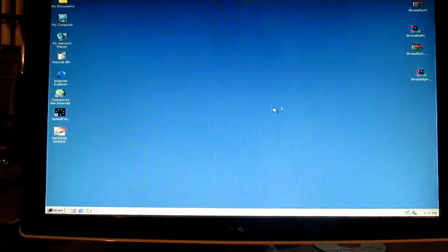The thing is, as some of you probably know, but I'll explain this to the new people, a RAID 5 volume, or partition, as Windows likes to call it, requires 3 drives minimum. And how it does its data protection, or redundancy, is it uses 2 bits of data and then 1 parity bit. The parity bit references the other 2 regular bits, so if one drive fails in the RAID 5 array, it can be rebuilt using those parity bits.